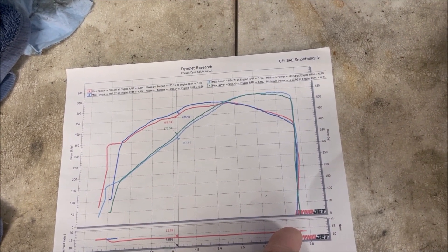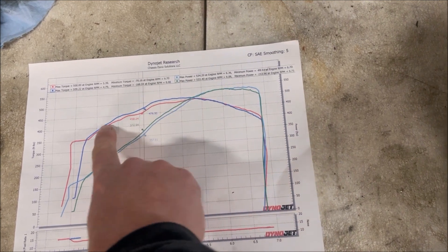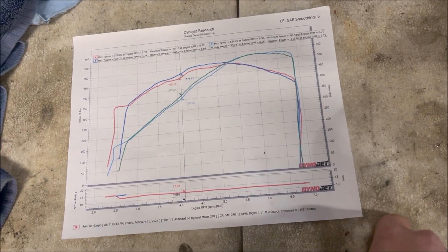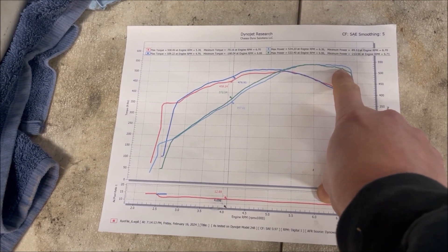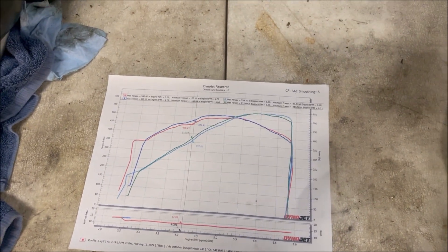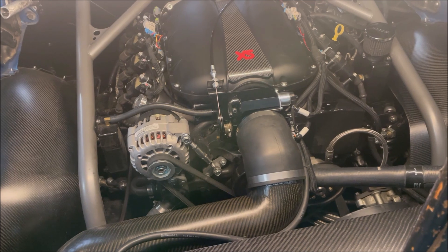The power we're losing down low is a killer, and I feel it driving it — about 20 foot-pounds of torque from about 3,500 all the way to 5,000 RPM. If we autocross this car, that's the meat of the pie. The stuff up here at the very peak — six or seven horsepower — is nice to carry power like that, but I'd rather keep it down low. In our next video we're going to show you what we did to put a cable on this thing, and we're going to test two different throttle body sizes. Thanks for watching.